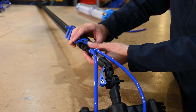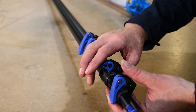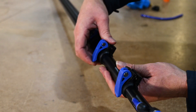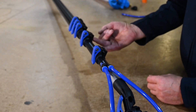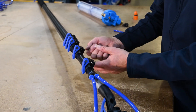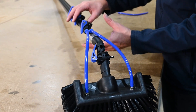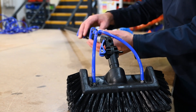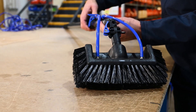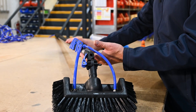These are all adjustable — there are six altogether. They're quick release fasteners, fully adjustable with a 3-4mm allen key, so you can adjust the tension. It is important to keep these nice and clean because any kind of grit that falls into these will score the actual aluminium casing, so do try and keep it clean.